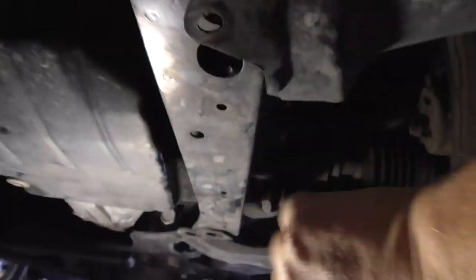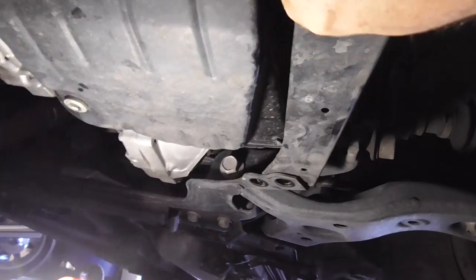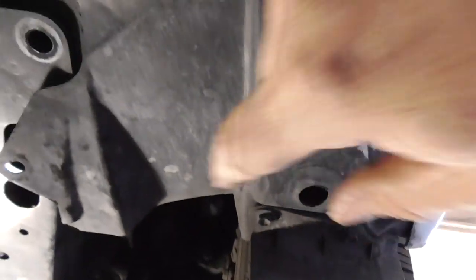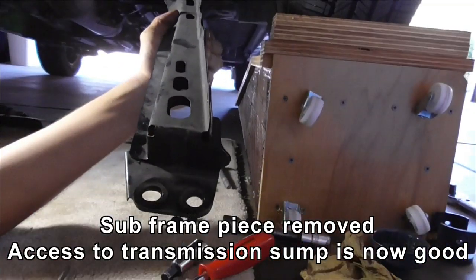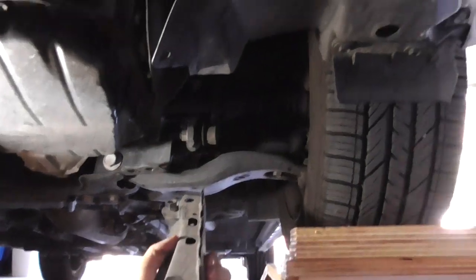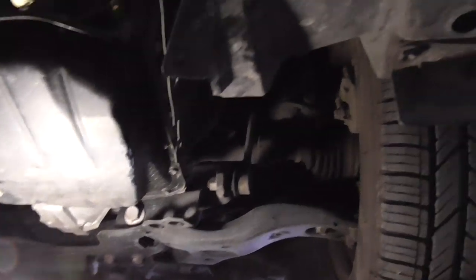After we took them out, we're looking to see if we can see the bolts. There's a piece of plastic still hanging on — we're going to have to take that piece off too, because you can't quite see the bolt heads. So we'll just take the whole thing out. Three plastic rivets to get off — two are visible and one is hidden behind this piece. And there is the subframe piece removed. Nothing moved when we took it off, so everything is fixed. Now we have nice access to all the bolts down here and across the back, so we can go ahead and do the pan removal.